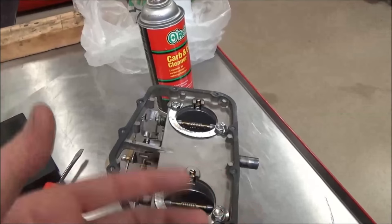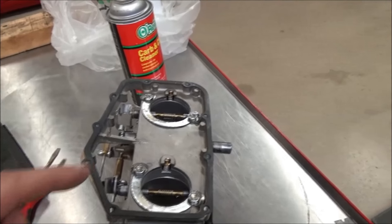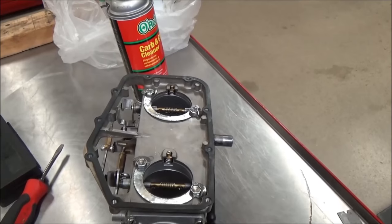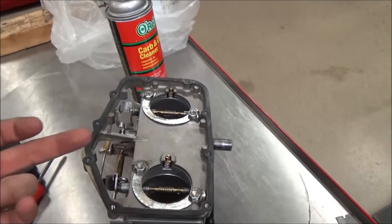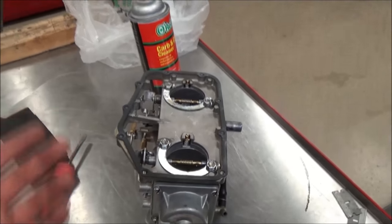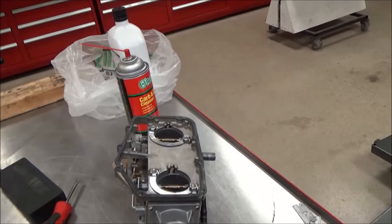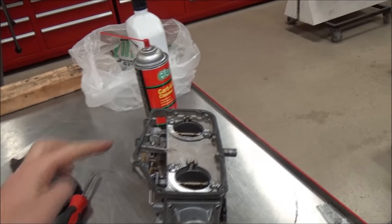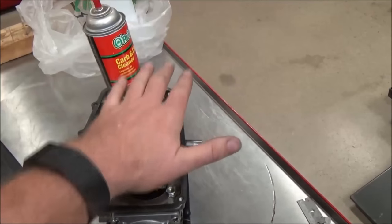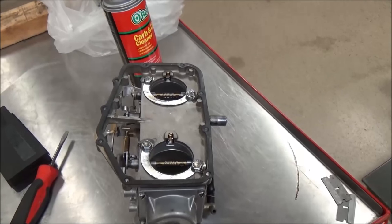I don't have a lot of room behind this because it's very tight to the edge of the hood of the boat engine, so it's going to be a back-and-forth gamble. I'll go ahead and put the right stuff in there, torque these down, and eliminate that gap in the back which would create an undesirable leak. On this boat engine where it doesn't use a filter, it's not as critical as dirt bike or ATV engines, but this will keep it designed as it was supposed to — air coming only from the front of the carburetor, not bypassing areas that could allow dirt or contamination to get in.